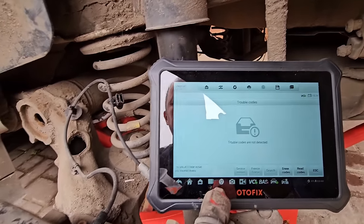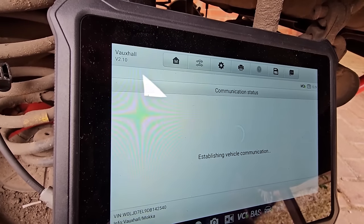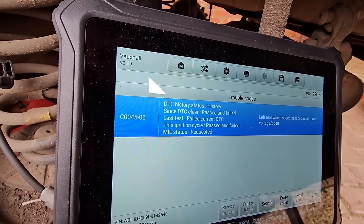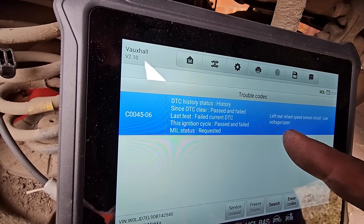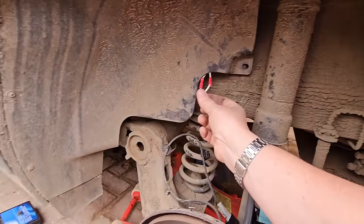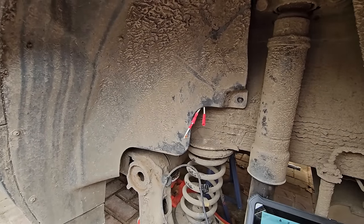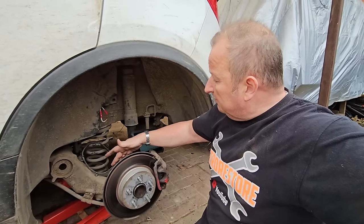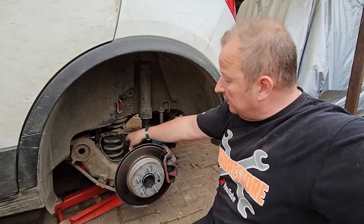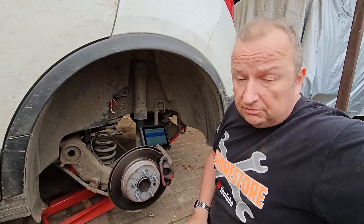We turn the left hub and the right rear speed sensor reading comes up on the diagnostic — which it does. So we've just proved that this wheel hub and sensor are working absolutely fine when fed from the right-hand loom. The problem lies with the left-side cables somewhere in the loom going to the VCU, which makes life a hell of a lot harder.